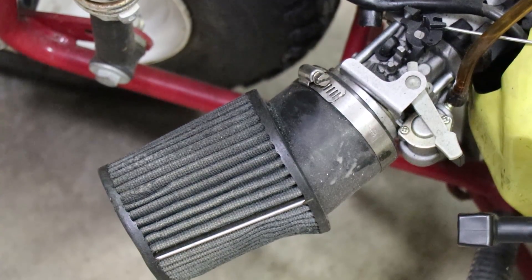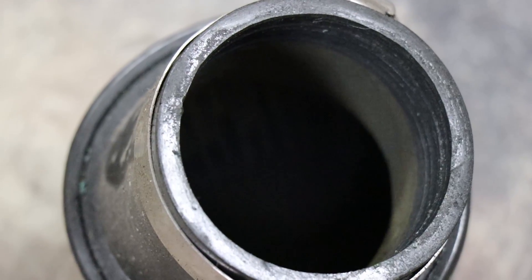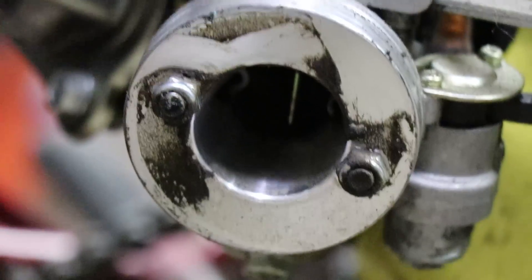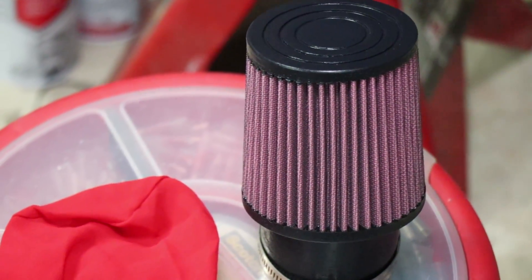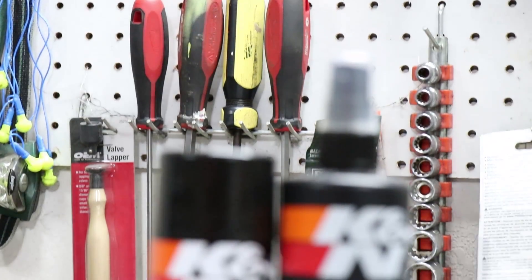It's pretty easy to clean these things. This came off of a go-kart engine and it never had oil. You can see dirt on the inside and you can see daylight coming through it — this stuff gets into your engine. That's why you need to oil an air filter, or if you got a brand new one, you need to oil it even before you install it on your engine.